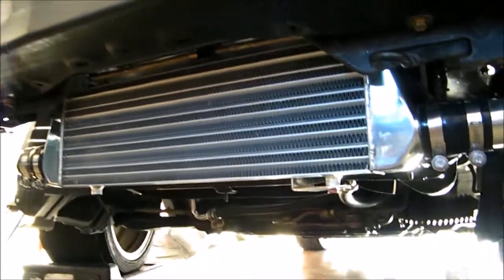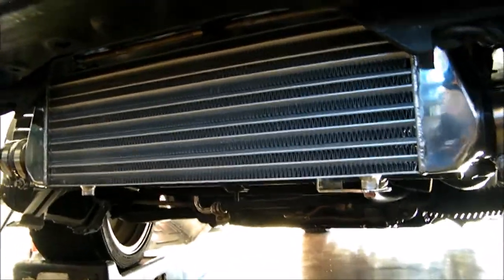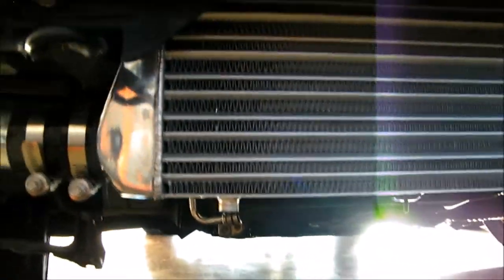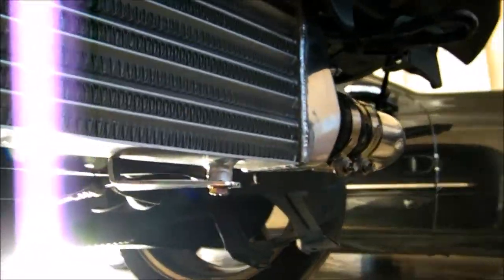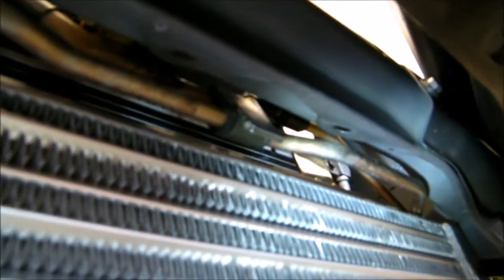This part is about the installation of the intercooler. The main thing about installing this larger 28 by 7 by 2.5 inch intercooler is that it's larger and you have to make clearance for it. It's substantially bigger than the stock intercooler. Up here in the front you have the power steering lines, and you've got to move these lines up and then forward because they'll hit the intercooler. You'll need to make some brackets for them.